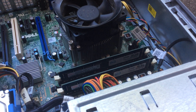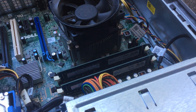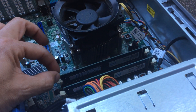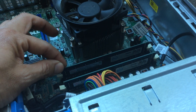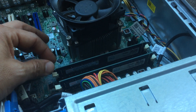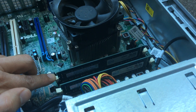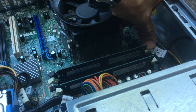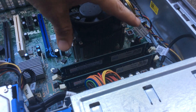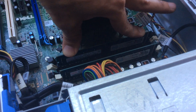it could be FedEx, USPS, UPS — they handle the packages very roughly. So when the customer gets the computer, sometimes the RAM stick will be just a little out of place. All you as a buyer have to do is open it up, open both locks on each side of the RAM stick, and then push the RAM stick again.